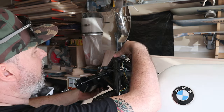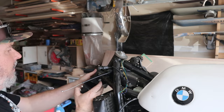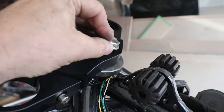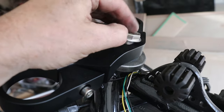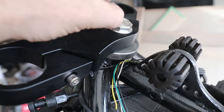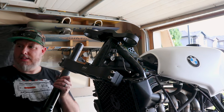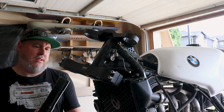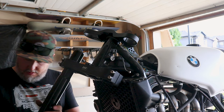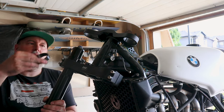The taper bearings I'm using were replaced just last year, so I reused those and I'll save the extra set the kit came with for a later build or future maintenance. After making some adjustments to the bottom part of the triple tree, all you really need to do is add the stem bolt — this is an absolutely beautiful piece that Jack's sells for the head stem to hold the top half in place. Make sure you torque that down because they have a tendency to fly off when you're driving down the highway when they're not torqued to spec — ask me how I know.